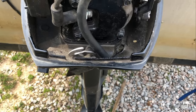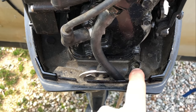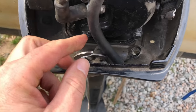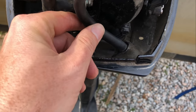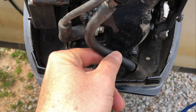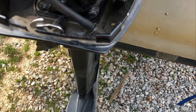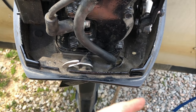Well, it didn't pump fine. As you can see, I'm missing this part right here — this little nipple that comes through the shroud where the water pumps out. The reason I'm missing that is because on the lake I said, 'I know the dirt daubers aren't in there because I ran the wire all the way up to about here.' I said I know I'm good, but I couldn't get any water. Always check to make sure your motor's peeing out the back — if not, you could burn your engine up. So I took this apart and that piece fell out in the water somewhere.